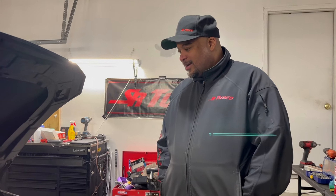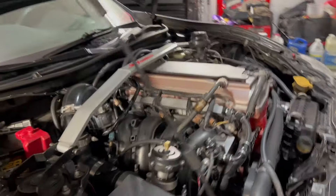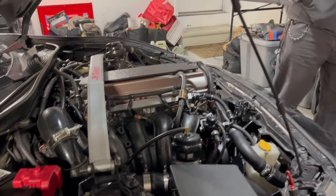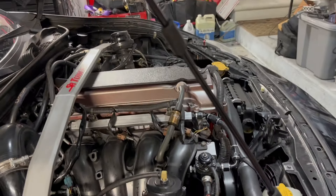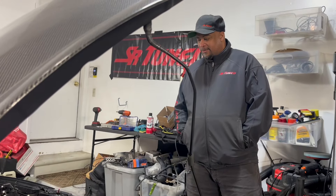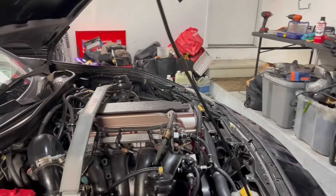Nobody's really doing anything notable with this motor, but I have been. I've been helping a lot with the Scion community, just trying to keep it alive. I've been running this motor since 2018, and this particular one is built bottom-end — forged internals, springs, Crower, Supertech turbo cams, 11:1 compression pistons. I'm running a turbo from an Evo 10 and a custom exhaust manifold.